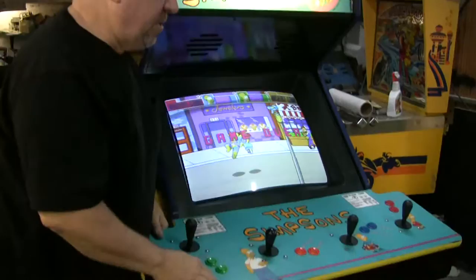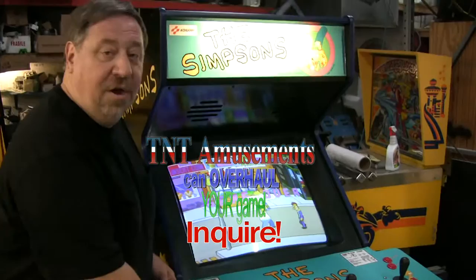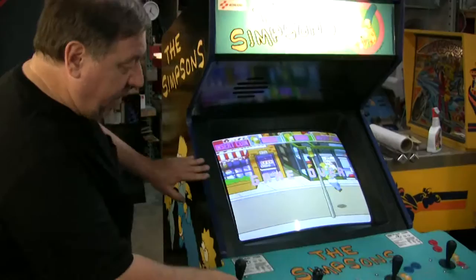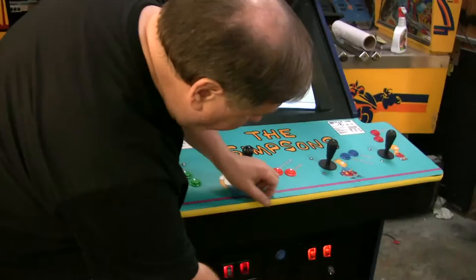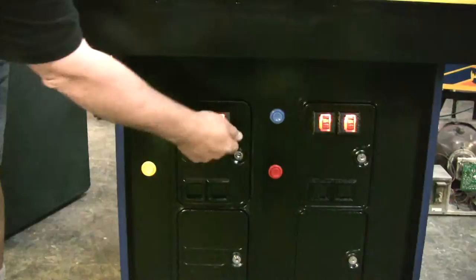Beautiful job — it's all been restored. This was an actual overhaul. A customer bought one of these on eBay and it was dreadful when it came in. Everything was hanging off. It had a plain black overlay — we soon changed that. New T-molding, new buttons, the joystick and everything. All the wires were yanked off. It's all been fixed. We put in free play buttons with slide-on terminals, so the person could convert it back to coin-op if they wanted. Each one is color matched cleverly to the player.